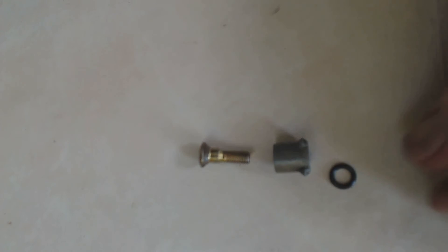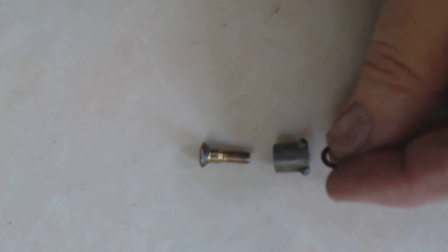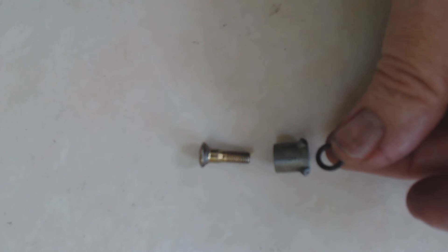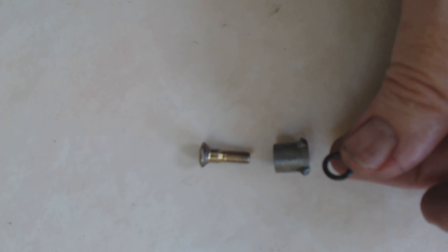The quick solution is just to replace the paper gasket with another paper gasket. I was looking for something a little bit more permanent, so I went to the parts store and bought the same size O-ring — a quarter inch by three-eighths by one-sixteenth.